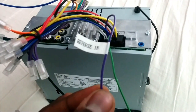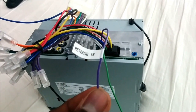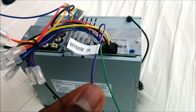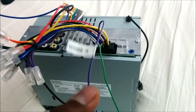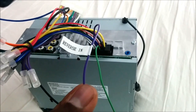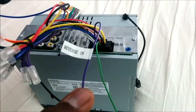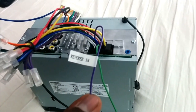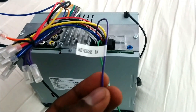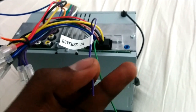There are two ways to do the rear view camera setup. The first way is to take power from the reverse light and give it both to the reverse camera and to the reverse input wire. So when you put the car in reverse, it immediately switches to that source, the camera gets power, and it displays the picture.